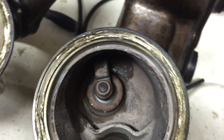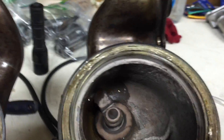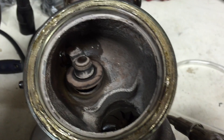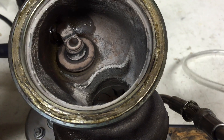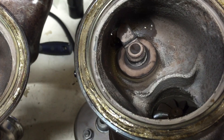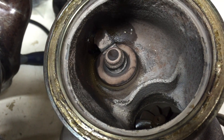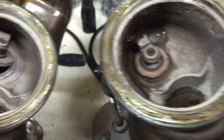You'll see here that this wastegate is closed. On this one it's fairly tight because I did the nut adjustment that people recommended — now it looks like it's tight, but it's not actually tight. Notice how when I release the vacuum, notice how it opens. It goes flat and then closes. I'm going to crank it until it's flat at 5.9 — there, it's closed. Now see all the play that this has. If I close it all the way, see how it opens up in the corner and it pops open? That's just because there's so much slop in this component — it's completely worn out.